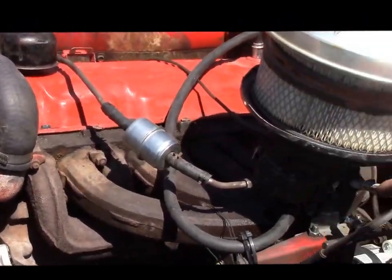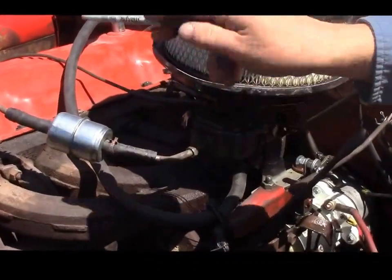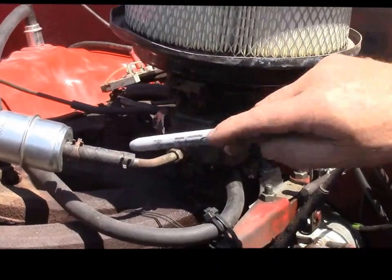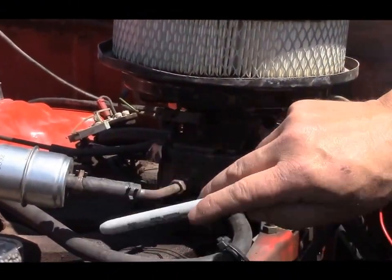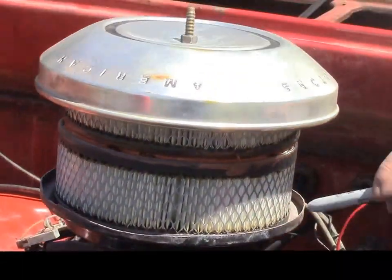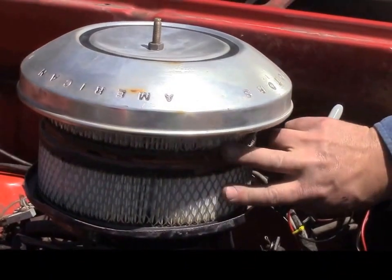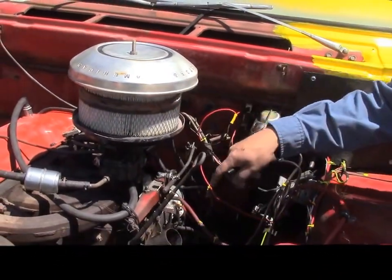For the carburetor, we took it apart and cleaned it. We've replaced the fuel lines, cleaned them out and replaced them, and we also have a new fuel filter here, so you won't require another fuel filter. Cosmetically, we've put on a dual air filter — you won't need to do anything with the filter either, because everything is clean.